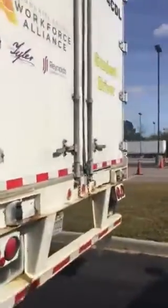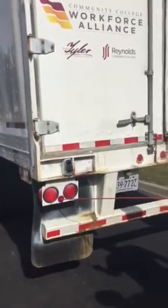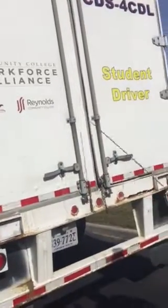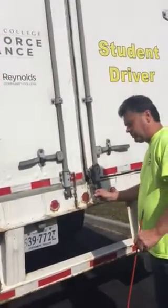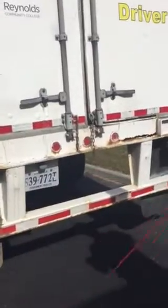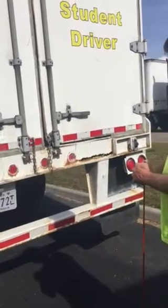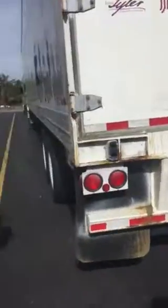I'm going to move around to the back of my trailer and start with the lights. My trailer clearance lights, trailer ID lights, trailer running lights, turn signals, brake lights, and reflectors are not bent, cracked, or broken, missing nuts, bolts, or screws. They are red in color. Then I'm going to go to my door hinges — they are not bent, cracked, or broken, missing nuts, bolts, or screws, nor are they missing. My door handles are not bent, cracked, or broken, missing nuts, bolts, or screws. Then I'm going to go to my door tie-downs or chains — they are not bent, cracked, or broken, missing nuts, bolts, or screws, nor are they missing. My DOT bumper is not bent, cracked, or broken, missing nuts, bolts, or screws, and my DOT tape runs the entire length of the bumper and is not chipped, cracked, or peeling. That concludes our outside pre-trip. Thank you.